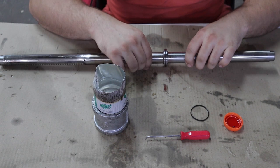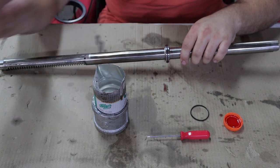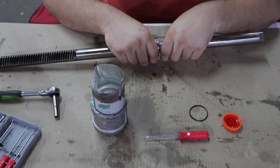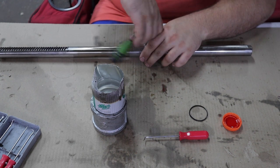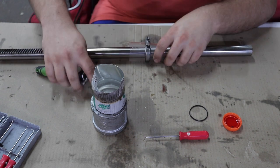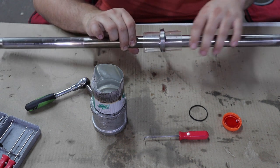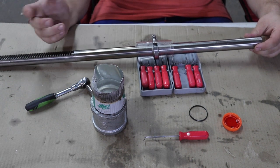Got it. Now we're not finished yet — you need to compress this thing and make sure it stays on. To make sure it compresses back down we're going to put this sleeve back over it and then hose clamp it — get the clamp right over the seal and tighten it down. We'll let that sit for a little bit to unstretch what we did.